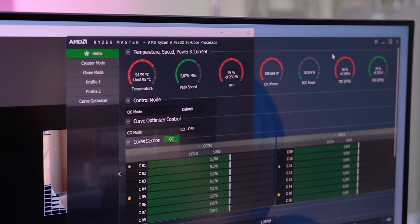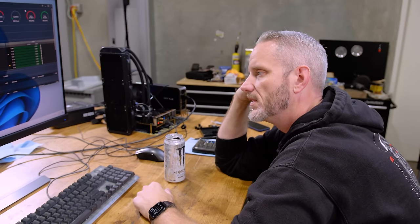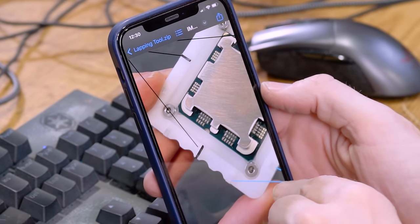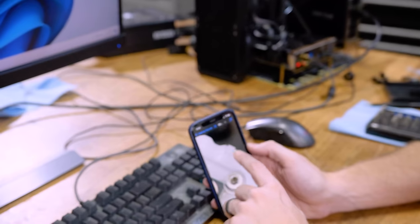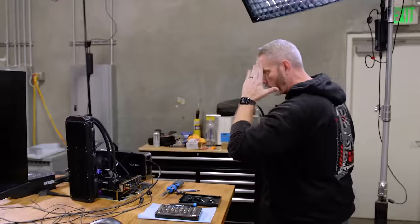Yeah, I think we're still running into a slight mount issue. There's 95C again. We're having a mixed bag of getting it mounted flat and not hitting the bracket. These markers on the side - that's the lowest point you can go. I have not gone that deep. The maximum removal is 1.2 millimeters of thickness off the IHS. Each one of those steps - those little stairs - is 0.4 millimeters. Since I'm down to the last step, I've taken off approximately 0.8 millimeters. I have not gone as far as I could go.